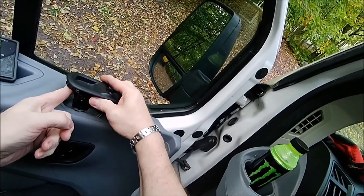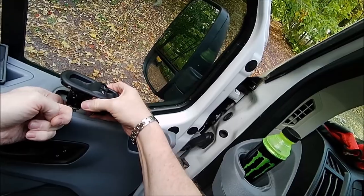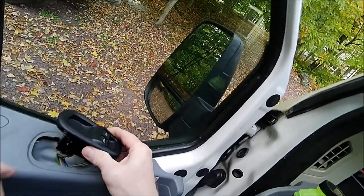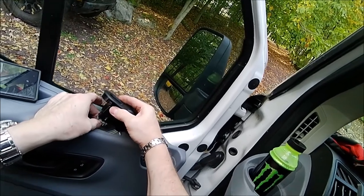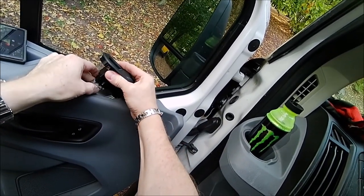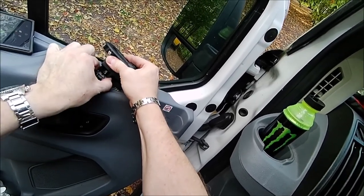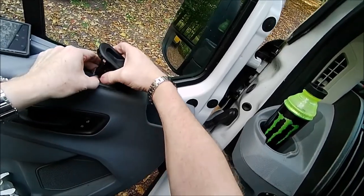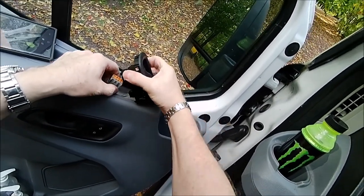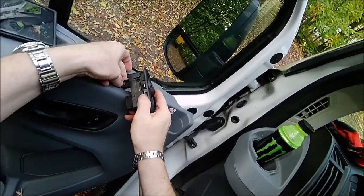You have to wiggle it a little bit, hold this little piece in here so it's not going to pull wires, and pull it up and get enough slack that you can get in here. You're going to be hitting this little lever here, and that will release the back piece. Or at least it should anyway. They're on there from the factory, so they're tight, so a little wiggle gets it out of the way. And then on the back side of this, you have another little lever here.